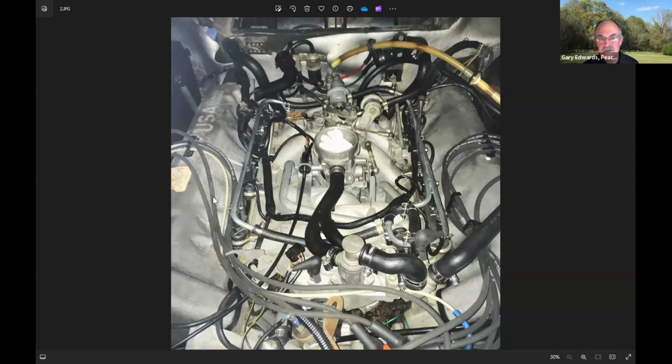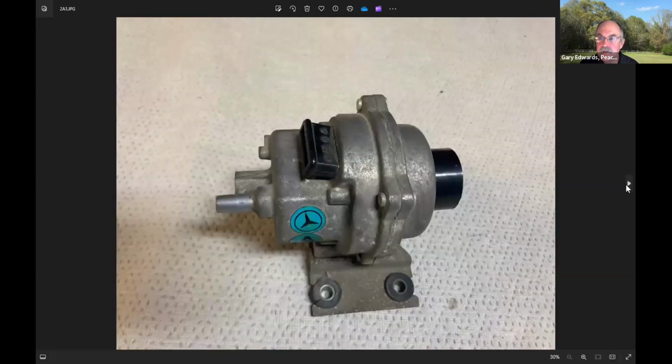And the obvious thing to do is to go look under the valve covers. I knew that I needed to adjust the valves because we had no indication of when that had ever been done. So I pulled the cam covers, or the valve covers, and I set the engine to top dead center on number 1. That's the manifold pressure control sensor, by the way. Okay, so this is just the engine set at top dead center with a lot of paint marks on it.